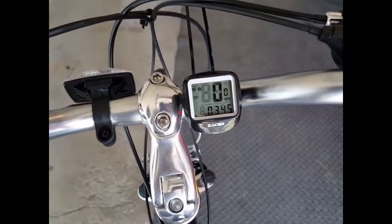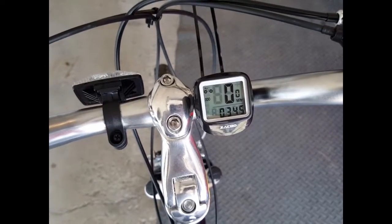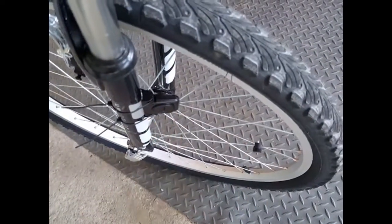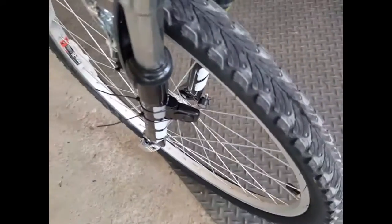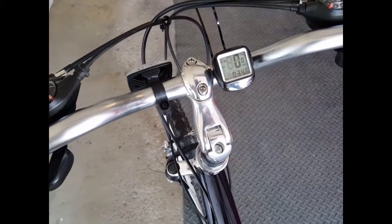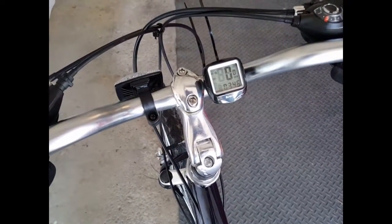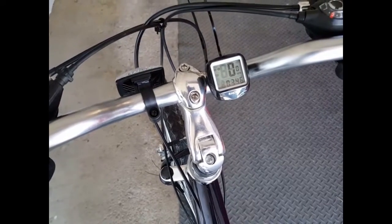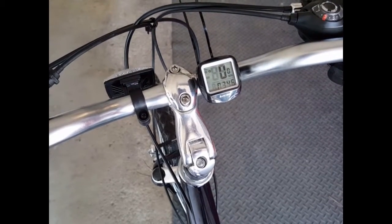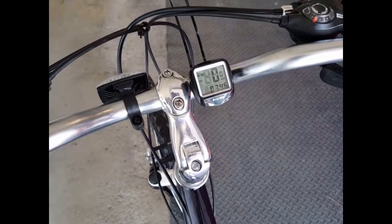It's a pretty cool little addition to my bike, and it works great as of now. Just got to make sure that the magnet and the sensor, when the wheel goes around, there's about three or four millimeters of distance there, or else it doesn't work — I had to move it a little closer. But other than that, it's pretty easy to install. It works just as it's described, and I'm going to give it a five-star rating. Thanks for watching.